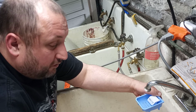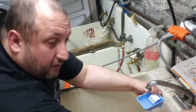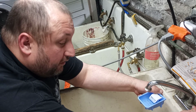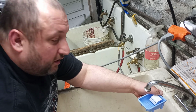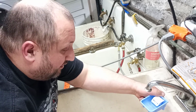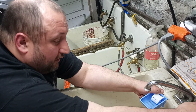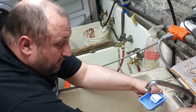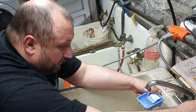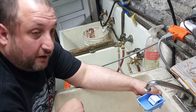So what happens is, when it's time for it to dispense that product, the water comes out of jets in the top, just right above each of the dispenser cups, and neither of them come on at any one time together. They only come on when it calls for that specific product. So when it calls for that product, the spray comes on, goes in there, and fills it up. As you can see, it starts coming out the bottom, and when it's not calling for it no more, it siphons whatever's left in the cup away.